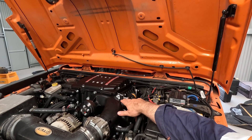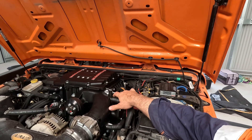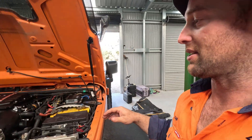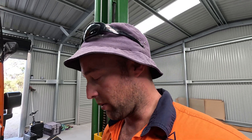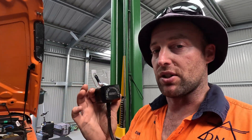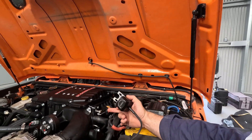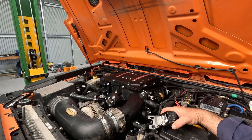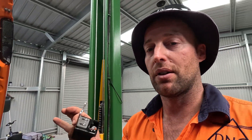It's because it's controlled with the stock vacuum-controlled bypass valve. The way it works, it doesn't kick in until really deep in the throttle. I've been doing a bit of reading and it looks like the smooth boost controller pretty much just replaces this vacuum-operated bypass valve with a throttle-controlled electronic valve. We're gonna put that on and hopefully it gives me a bit smoother throttle and more drivability. Haven't seen any other videos with one of these on a Pentastar, so we'll chuck it on and see how it goes.